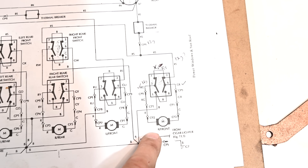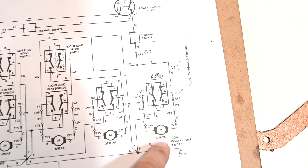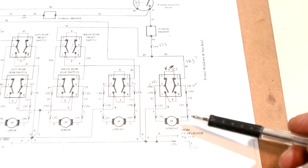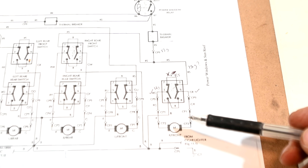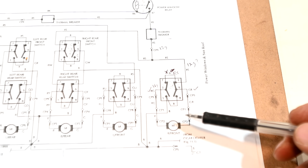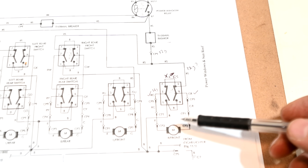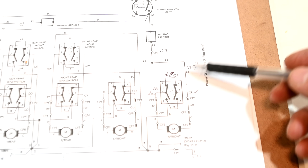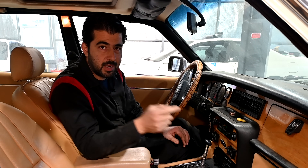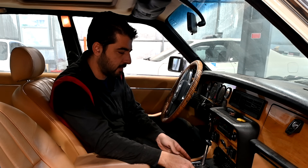One other thing: you could get a false ground reading if your component is grounded to the chassis. The idea is to make sure you remove the ground from the circuit you're testing for a short to ground — whether it's grounded to the chassis or grounded at a connector going to the ECM — disconnect that connector, isolate the power side, and then test for a short to ground. Hit that subscribe button and the bell notification because we'll be covering this more in depth in the future.